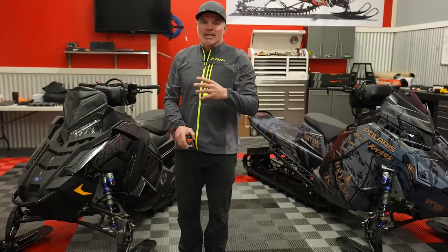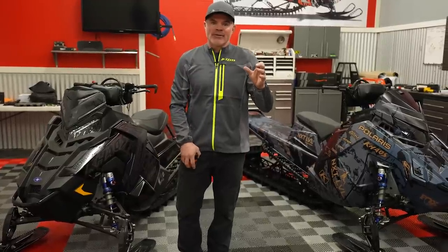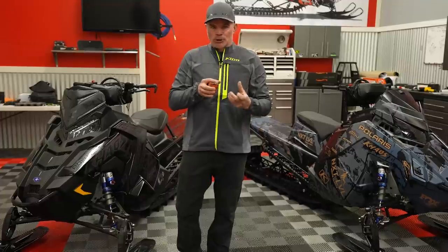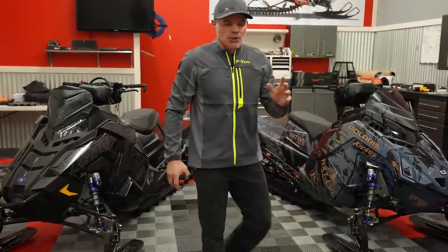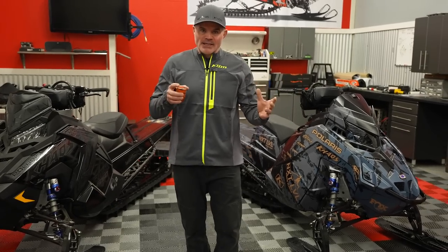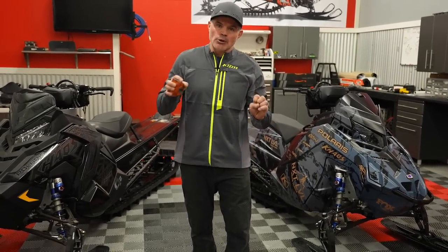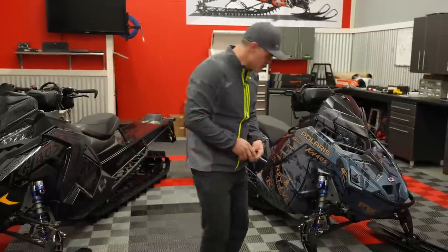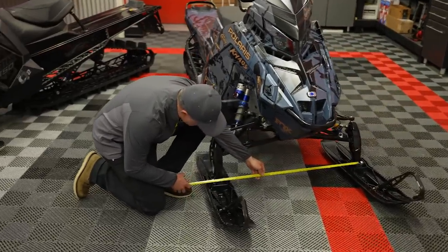This is personal preference, but I'm essentially the guy that will put those right in the center. I feel like you get a lot of ski rubber life by leaving it in the center — that's where the ski rubber has the most purchase and the spindle sits nicest in the ski. Not to mention I want a balance of how easy the sled is to initiate and get onto its side, but also how stable it is at high speed. Center is kind of my favorite.